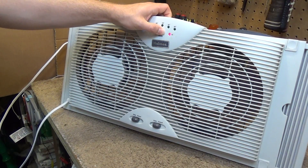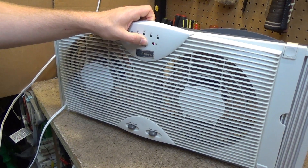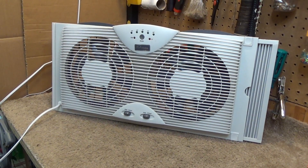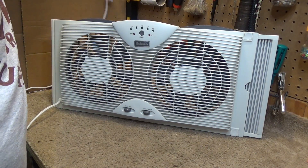Let's demonstrate what we have here. It's not so bad on high — it's on low that it makes the noise. I don't know if that's going to pick up on video or not. It's only the right fan; the left fan is quiet. Okay, that was the left fan and now this is the right fan. So let's see what we can do about that. I'm noticing the spin-down time is a lot shorter on the right fan, though I don't think that should cause it to make such a humming sound.